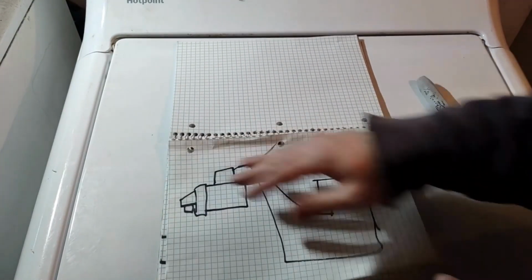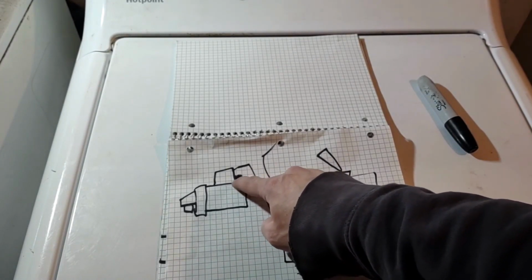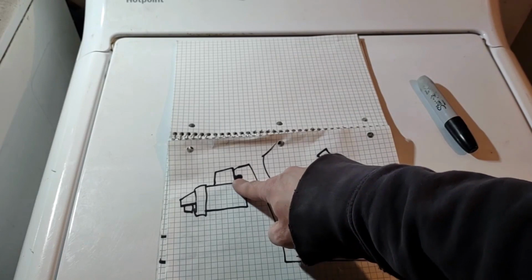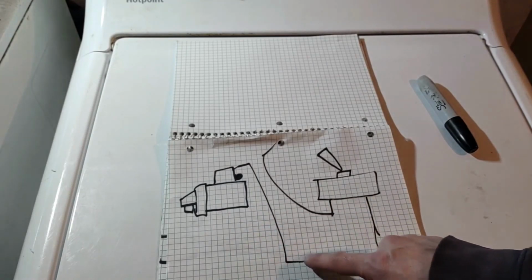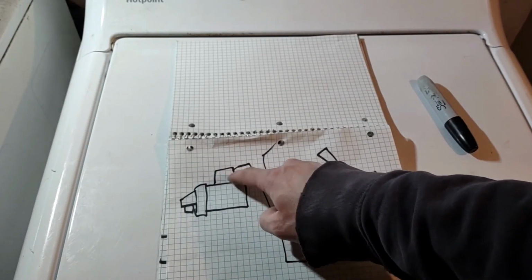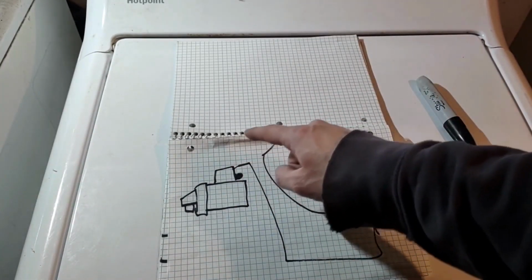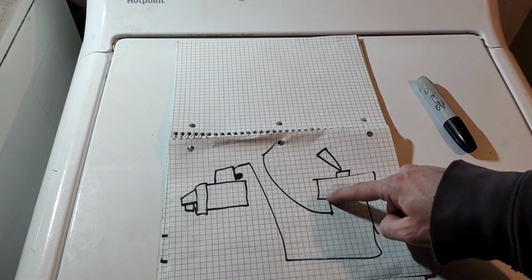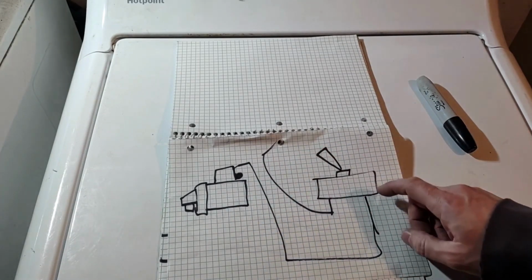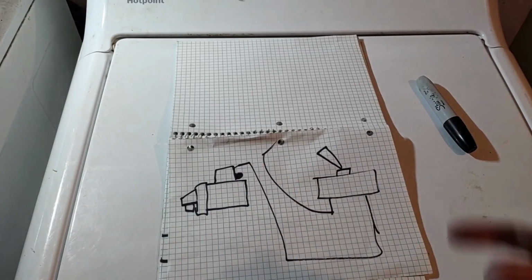And then I wanted to make this one too for the starter. So normally your starter has a really big lug that goes to the battery typically. Then there's this little one that comes off, and that's coming from the key. So this actually tells it to start. There's always power here, but this is what tells it to start cranking basically. So what we've done is normally it would come here and go there, but we've once again run it to the switch. The switch is on, keeps going, works as intended. If you flip it the other way, it won't come out here. Starter won't work. So that's something else you could do if you really want to super duper protect it.